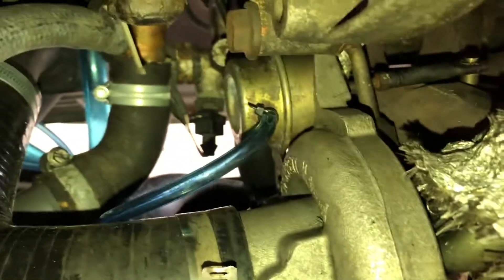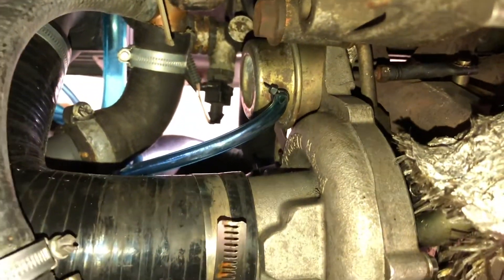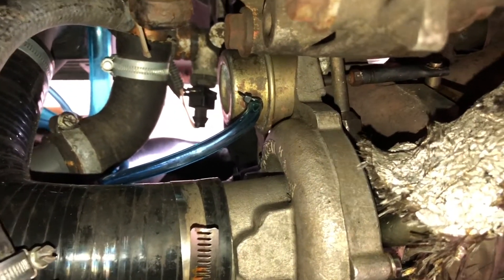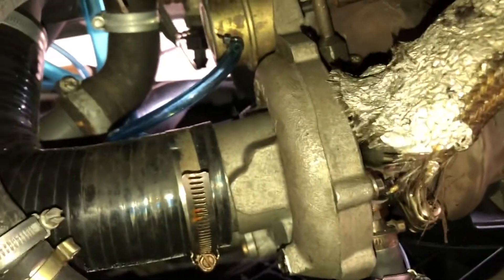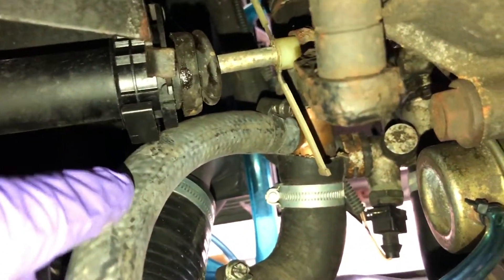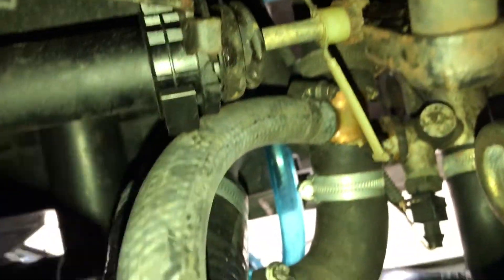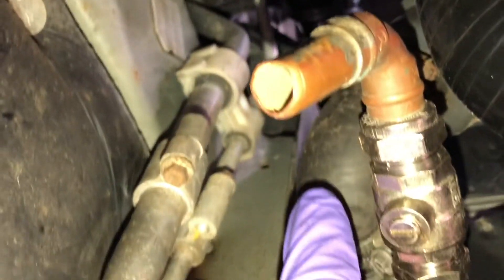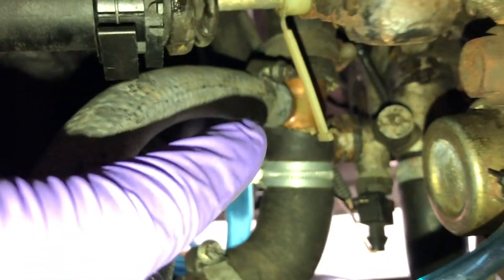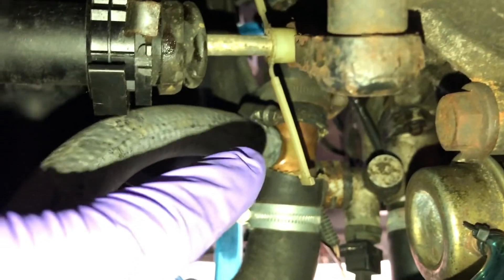What I did notice when I went for a short run — just testing this out, not very vigorously — is after I stopped the car you could hear the water boiling in the turbo. So it would be beneficial if it was cooled a little bit more. What I'm going to do is on this cold water feed, which comes around here on this car, this pipe here comes from the lower connection of the water cooling system for the radiator. So here is the lower radiator pipe. Up there, the other side of the PRT pressure release thermostat, I've got a T-junction — I think it's three-quarter inch plumbing down to 15mm plumbing.